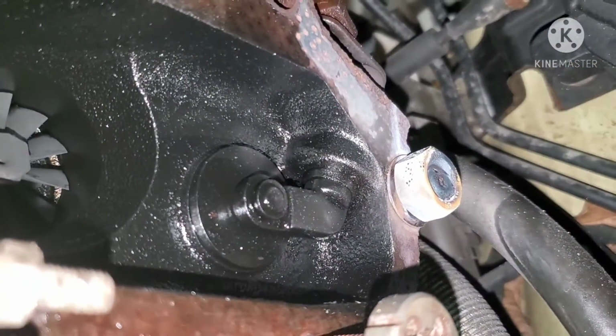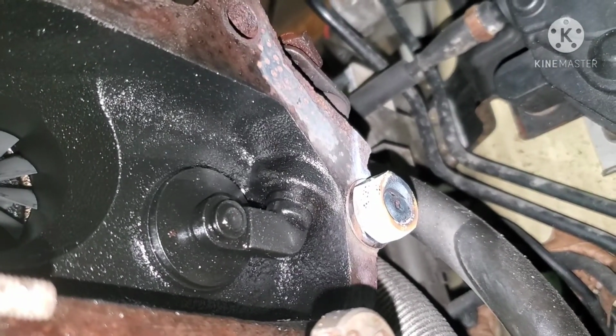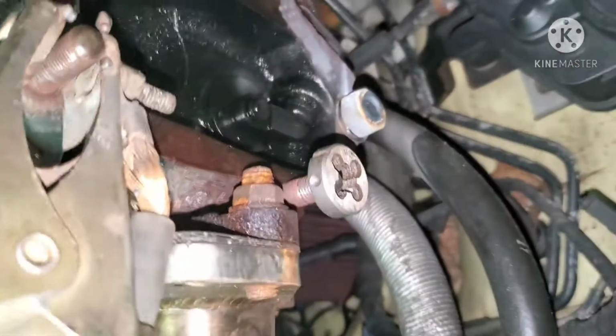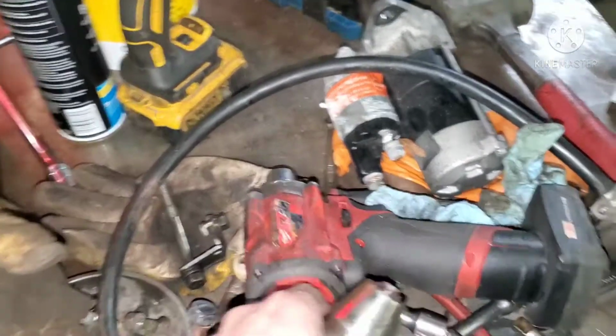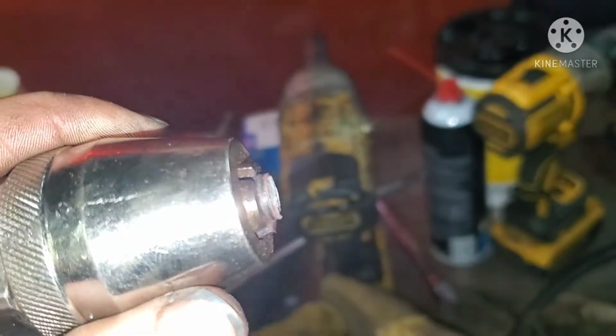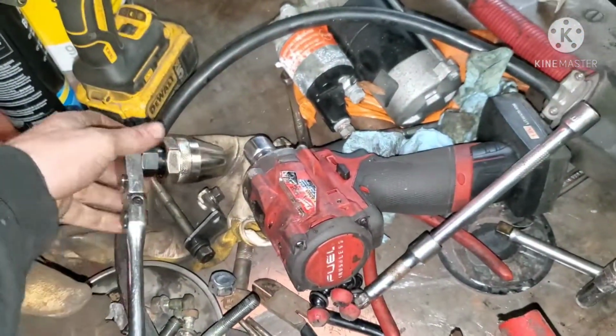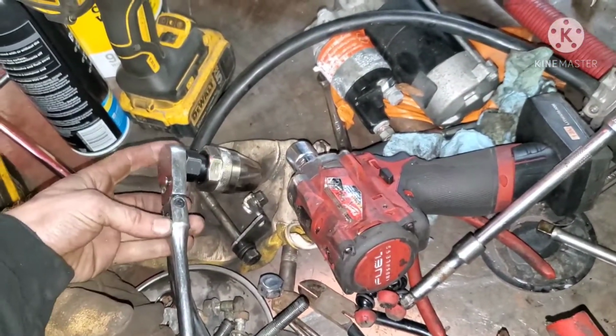Well, we went to remove the one stud that was completely stripped out from previous install, and the stud snapped. I should have known that was going to happen, but it felt like it was actually coming out. Should have heated the turbo up, but honestly don't know how much the MAP gas would have done, and our oxyacetylene is out of oxygen right now.